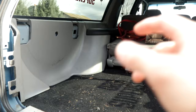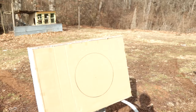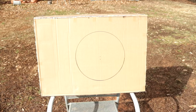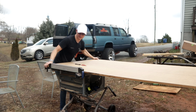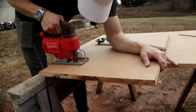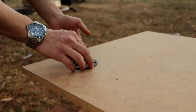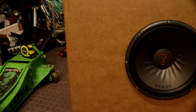Now that we're done with all our other speakers, it's time to get started on the bass side because we're going to put a subwoofer right here. We've got to design a subwoofer box that's going to fit in this slot after we cut it out — so back to the cardboard design. Already got our little box designed here — a little angled wedge box, sealed. We could do a ported but we're going to do sealed because it's a lot easier. Let's get this transferred onto some MDF and get it cut out. Box is completed, driver is in, everything looks good. Used some nice hardware on it. Got our electrical connection on the back and we'll wire that internally after we get everything sealed up and dried.